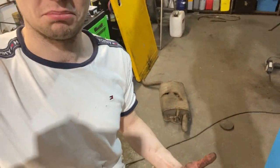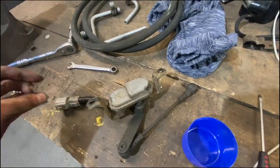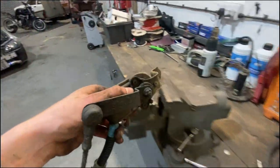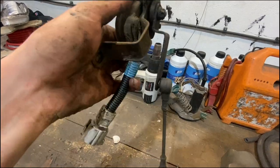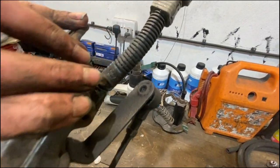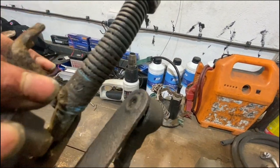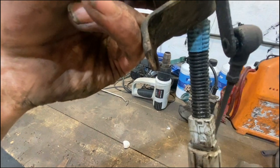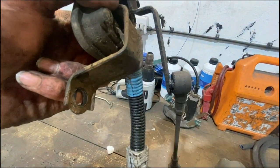We kind of cut the back boxes off as well — they're just sitting there until we get the exhaust on. Just wanted to see if we could get a slightly bit more noise out of it, but not really much because the back boxes literally had a hole in them. So moving on to the front then — I undid the bolt, which was pretty easy to see but quite awkward to get off. Finally got the front sensor out — the clip was ridiculous and tight, just dirt stuck in it. As you can see, this side here was threaded — dead on. This other one I don't actually know what kind of fastener it is because I can't see behind it; it just looks like it's tapped or welded. So I'm going to try and get it off with vice grips or something, and if not I'll just cut it off and drill it out.